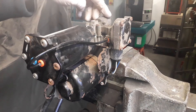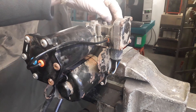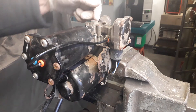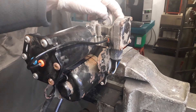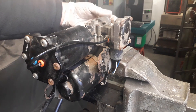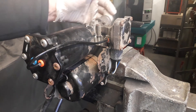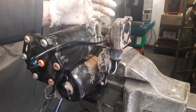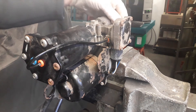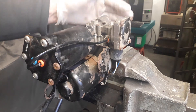Note these two pipes coming out of the back — one's 10mm and one's 8mm diameter. The 10mm is the outlet pipe for the outgoing pressure, and the 8mm is where air pressure goes into the cylinder. Check on your vehicle that these two pipes are not blocked. You can disconnect them just for diagnosing, to see whether your fault goes away — they're not pressure pipes, they simply quieten the ingoing and exiting air. You can remove them and let them vent to fresh air to test.